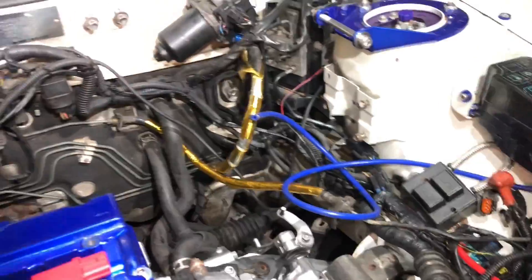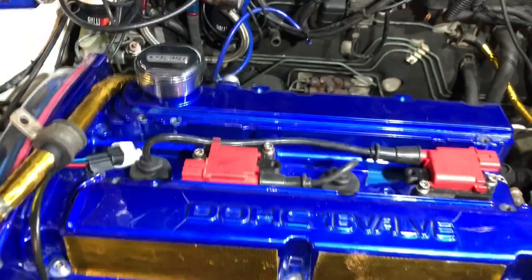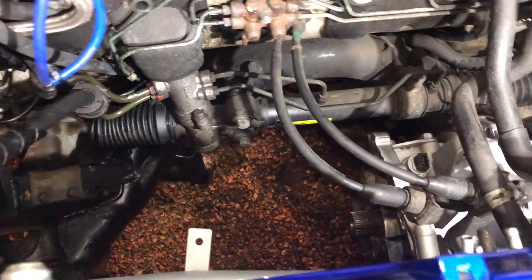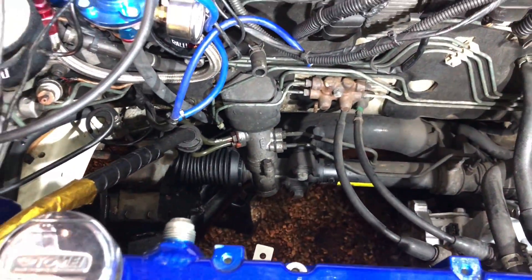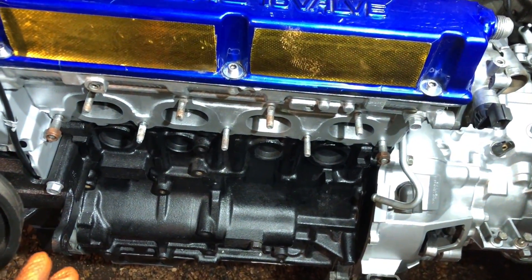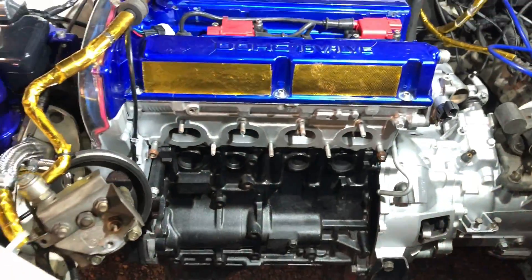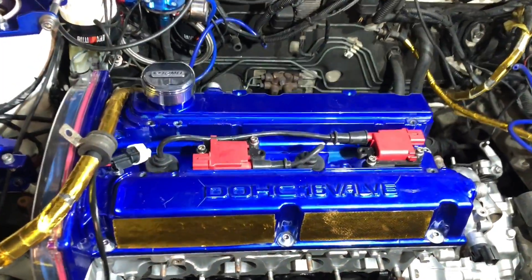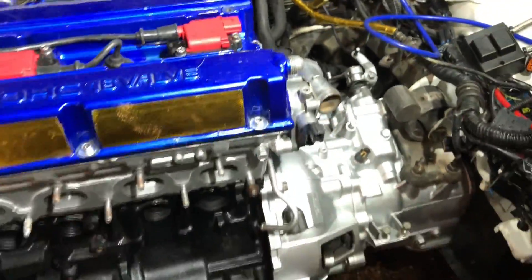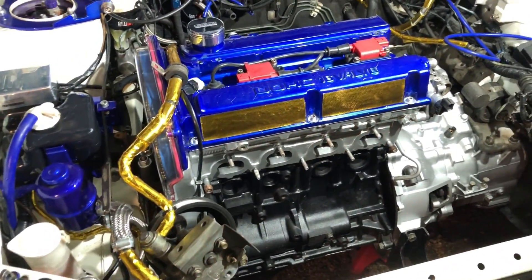You can see this massive wiring loom - drives me mad, but we'll sort that in the future. We've got the inlet bolted on that side, got the transfer case bolted on, you can see it down there, put the gear linkage on - basically getting everything back together. The main thing we're waiting on is the exhaust manifold - as you know that's cracked so it's off to get welded. Once that comes back then we can get the turbo kit on. We've only got to fill it up with fluids: oil, spark plugs, gearbox fluid, transfer case fluid. So I'm going to continue getting things bolted on so we can hopefully hear this thing run very soon.